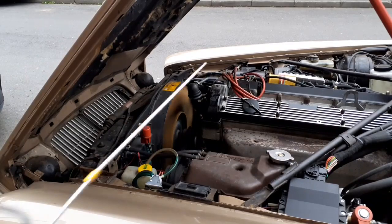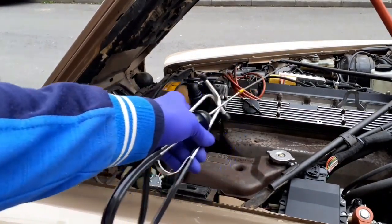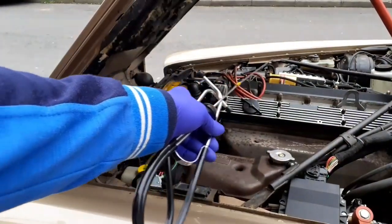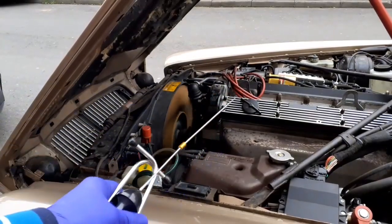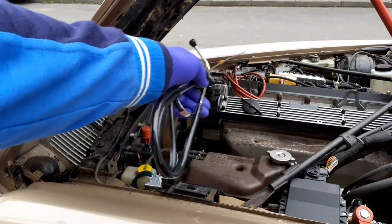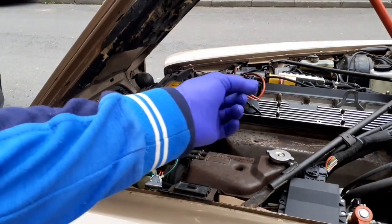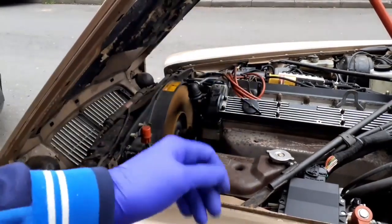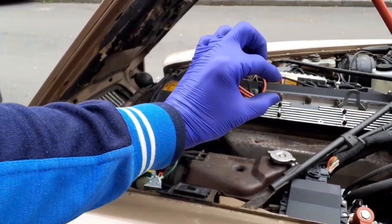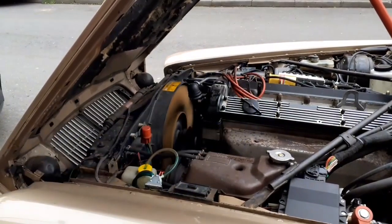It's funny, these fuel injected engines are slightly noisier. Not the engine itself, but the injectors are noisy. They're much noisier than the carburetor. A well-adjusted carburetor runs very silently. But the 6 Lucas injectors are quite noisy. They do tick, tick, tick, tick, tick. They open every induction stroke, no, every compression stroke. It's induction. They open and close on each induction. They're metallic inside and they click, and they do make a ticking sound.